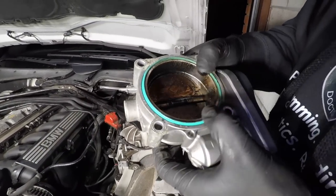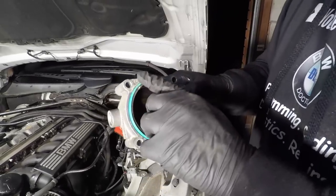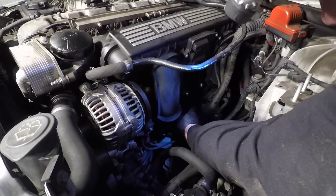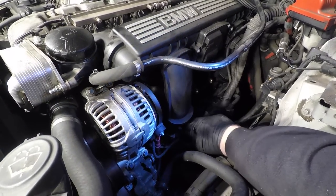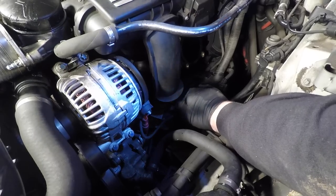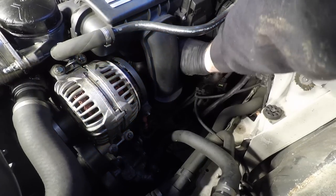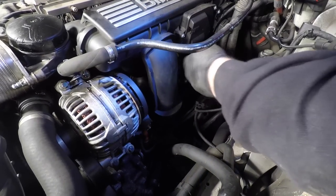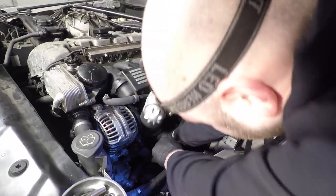That confirms we need to change the CCV. This boot has already been recently replaced — it should be orange, not green, so someone's already replaced it. As I told you before, someone's already been at this, because the bracket is missing a bolt. It's only held on by one Torx bolt — a Torx 30 — there are usually two. I find it easier to release them rather than pulling the clips. Just leave it hanging and you can take the intake manifold off. You also want to take off the brake booster hose — just push the clips in and pull it off with a flathead screwdriver.